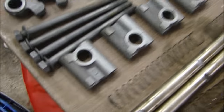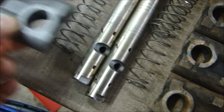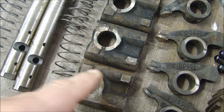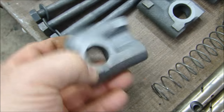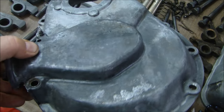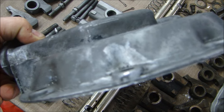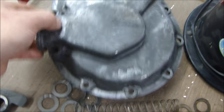I bead blasted my parts in my blast cabinet and you can see how nice these came out. This is how they looked coming out of the oven, and this is how they look after blasting. After your parts cool down when you take them out of the oven, you can just lay them out and take a look at them. They can come out looking brand new. Here are all the parts I cleaned up — one side just baked, this side baked and cleaned up — and you can see how nice and brand new all the parts come out. Finally, the cam cover: you remember how dirty this thing was, and all I did was spray it with oven cleaner, rinse it, spray it again, rinse it again with a little wire brush to clean out the corners. I can throw it in the blaster, clean it up again, and have it ready to install.